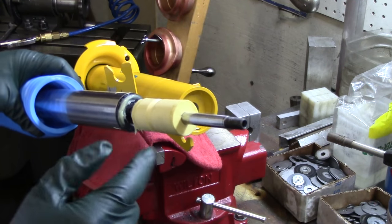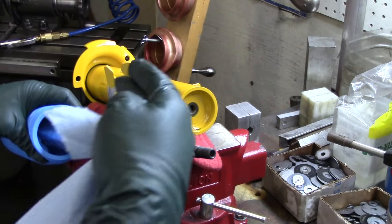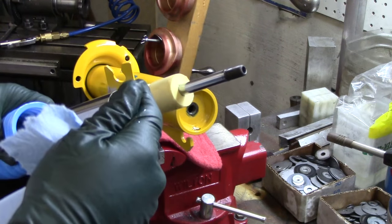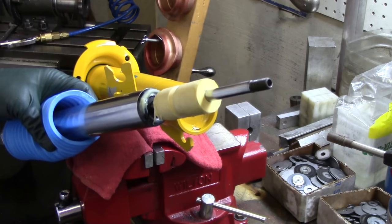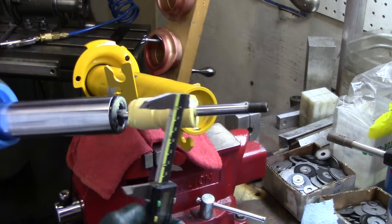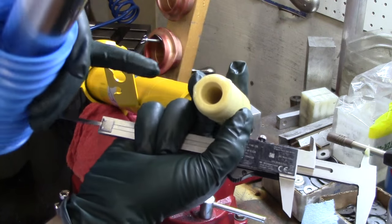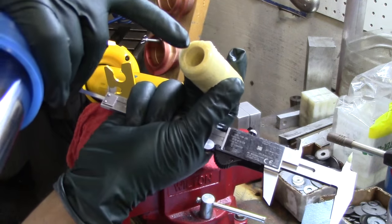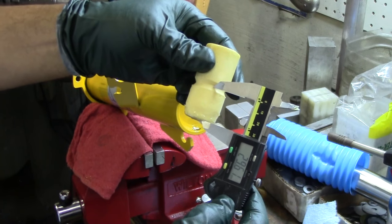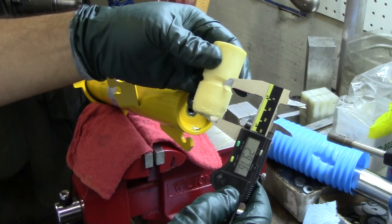And then you can see how much room you may have from the first uncut bump stop. Put it in with that, compress it, see how much room there is above the tire — between the tire and the fender liner, between the tire and any potential contact points. You want to turn the wheel and make sure that at both ends of lock there's no contact. This is really important for modified cars where you have wider tires, different offset wheels, wider wheels. Generally what I found is that you can take off the back section and retain this initial section, which has a little bit of a taper on it — so it's slightly linear. That's about 30 millimeters to the middle of the grooved area. In most cases we go to about 30 millimeters, then we add a 3 millimeter packer, sometimes a 6 but usually a 3 is generally adequate.